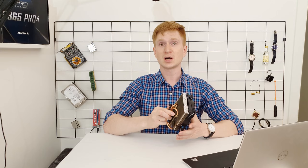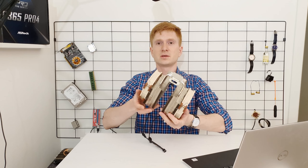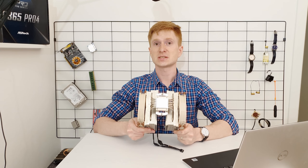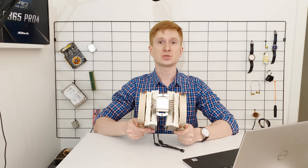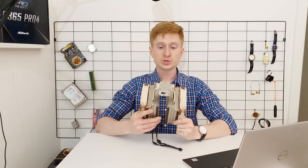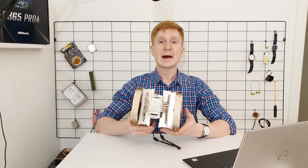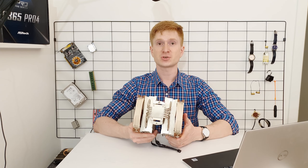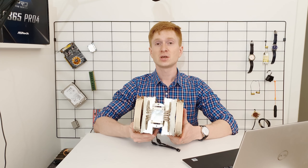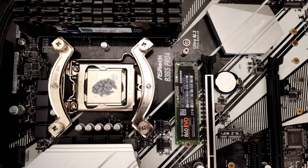The next step was to try my giant Noctua cooler. This beast is able to cool down basically anything — even an overclocked Xeon E5 1660 V3 consuming up to 200 watts stays cool under it. Unfortunately, even after installing the Noctua cooler on the QTJ1, I still got no better results. The CPU was still cooking itself up to 100 degrees Celsius and throttling, so obviously the problem was something else.